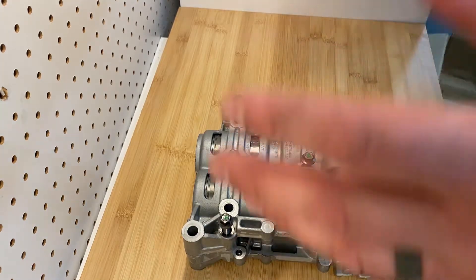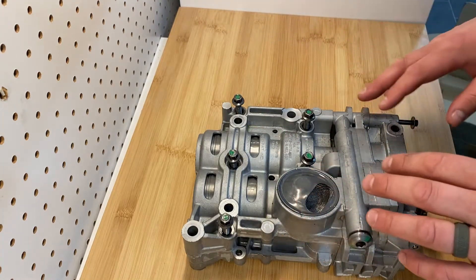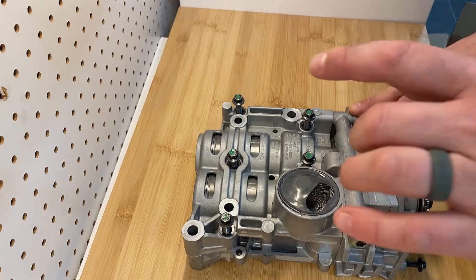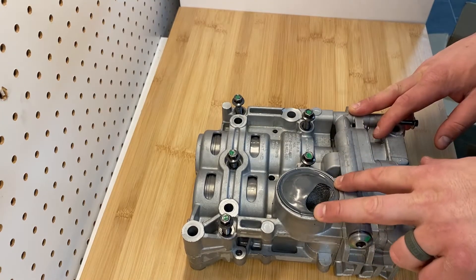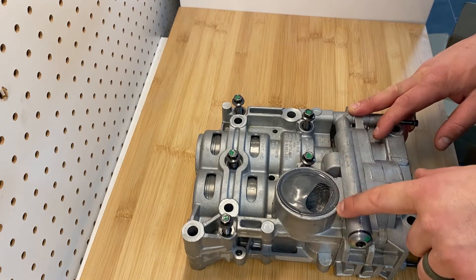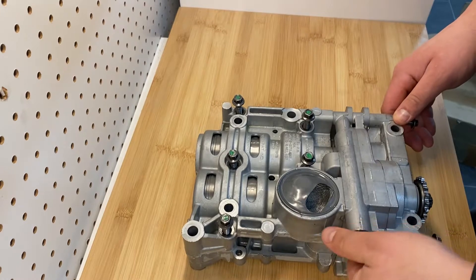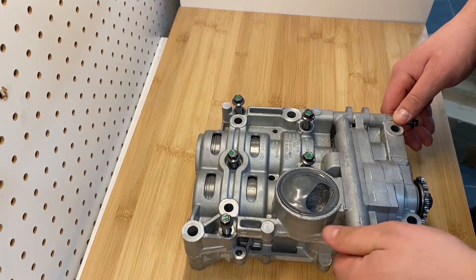For the sake of time, I've already loosened the visible bolts. There is a hidden bolt that I'll show you in a second. First, you need to mark your pickup — you want to put it back in exactly the correct location, so you can do this by indenting the sides and then matching them to all mark up. Second, you're going to want to loosen this to remove your relief valve and spring, and clean and inspect them.